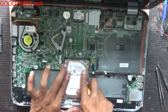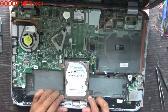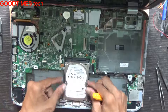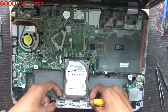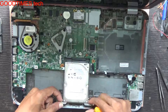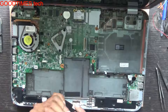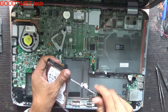This is the hard disk. Pull the hard disk gently backwards, lifting it up here a little bit, then pull it back. I'll show it once again — just hold it up and pull it gently backwards. Don't pull it too hard or you will break the connector.